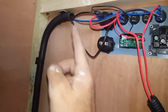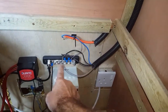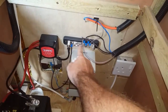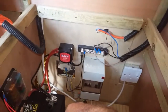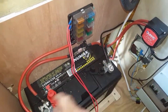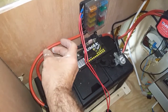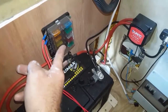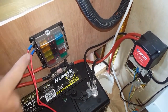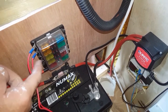So now my earths all go through this conduit and they all come out down here. This will be tied up to this bus bar. Now this bus bar, with this cable here, is connected to the negative on the leisure battery. So then all these are earthing points, I can earth things too. This is the positive on my leisure battery - one goes to the split charge relay, the other one here goes to my fuse box. I have just ordered another one of these fuses to put here - you need to put a 50 amp fuse before this fuse box. On this fuse box you've got all the fuses and terminals which can go to your appliances or your switches. So in this case this goes to the switch for my lights, and this goes to the switch for my USB port and my voltage reader.